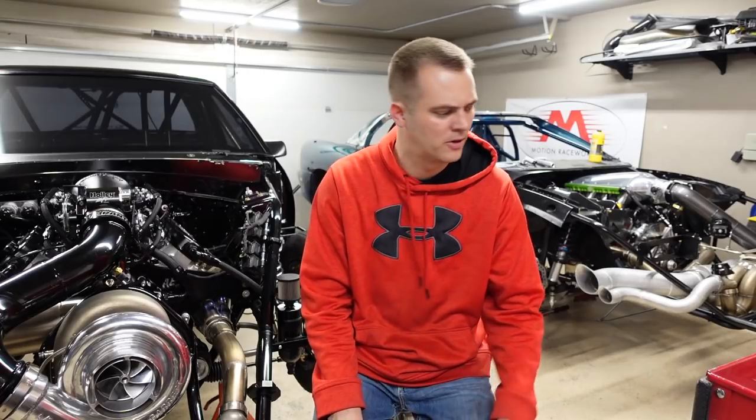Chris Clark wants to know the internals of the motor — nothing secret, it's pretty standard off-the-shelf parts. GM LS3 aluminum block, K1 crank, Muller Power Plus rods with a 3.62-inch stroke, and Wiseco forged pistons. CA625 head studs — not half-inch, still 7/16-inch but the CA625 spec. LS9 head gaskets — pretty standard. And then Brodix BR1 cathedral port heads. They're fancy heads. I got them because my hope was one day to build a legit short block and take the heads and intake over. The crash kind of set me back, but hopefully later this year I'll build a legit short block to go with the rest of it and maybe upgrade the turbo too.